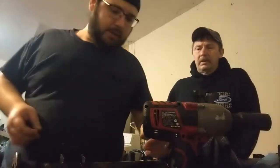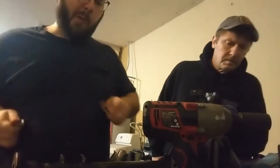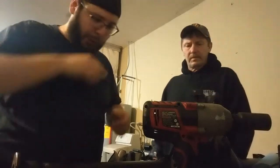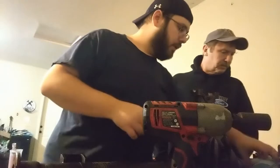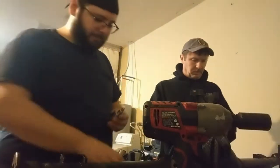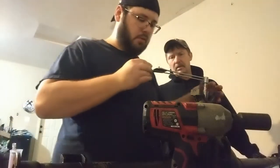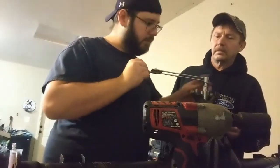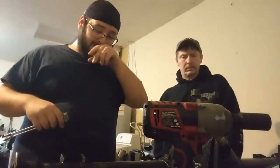This is the first time I've had everything that's supposed to go in there, like the seal. All that. I need my other... Where's that one socket? Oh, yeah. Preload zero. Breakaway torque is at zero, so we're good. It's where I wanted to be before starting to torque this down.